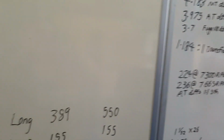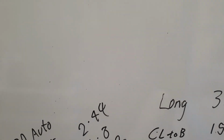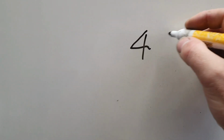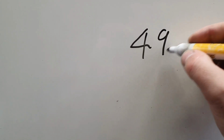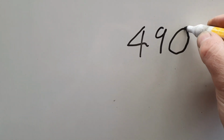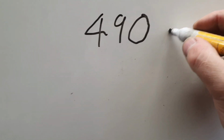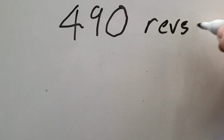So there's a simple formula that I've been using that's a piece of cake to figure out how fast you'll be able to go. You go and figure out what your, excuse the boring whiteboard with nothing on it, go online, figure out what your revolutions per kilometre are for your tyres. And in our case, for the 285/35/18 Nexen SUR4Gs, it's 490 revs per kilometre.